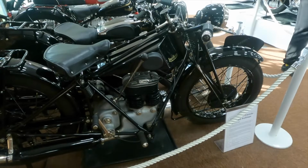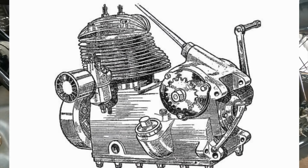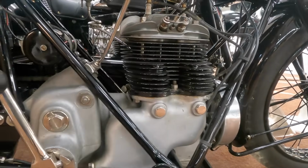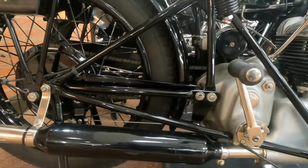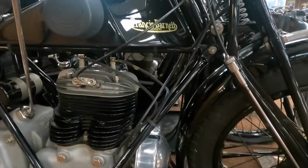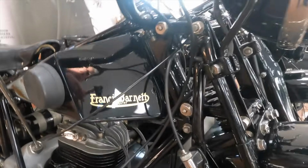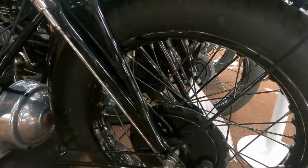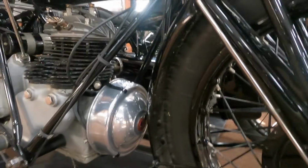But perhaps the most interesting design was the Pullman. Arriving in 1927, it made use of an all-new Villiers inline twin-cylinder 2-stroke engine of 344cc, which was married up to a 3-speed gearbox and had chain final drive. And while looking radical, the engine was actually just two of their 175cc singles mounted in line of each other, employing the same bore and stroke of 57 by 67, and using a crankshaft of 180-degree spacings, which had the usual Villiers magneto system mounted at the front of the engine.